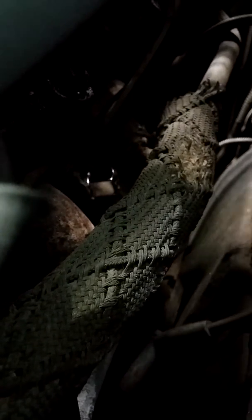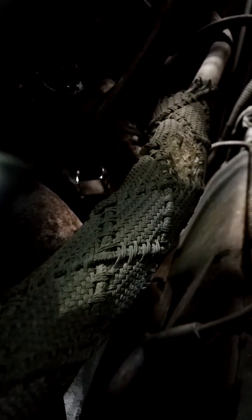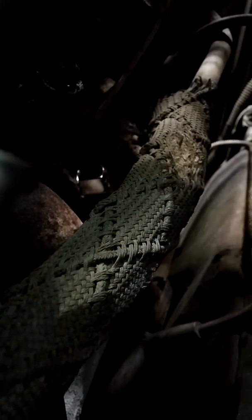Now, as you can see way back in there, I've got that socket on top of that spark plug, so now I just got to take my ratchet, put it back in there, bend it around the way I need it, and I'll be able to back that thing out. But also, just a tip, you might want to have one of those portable magnets if you drop something on the ground, or put something underneath it, some type of long, flat baking pan, in case you drop sockets or a spark plug, to make it easier to pull out. Just some small tip for thinking ahead.